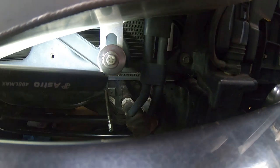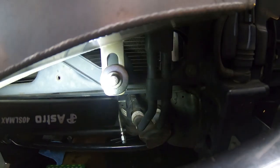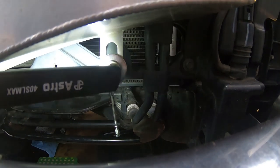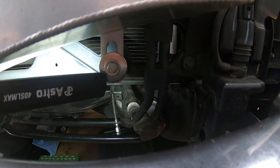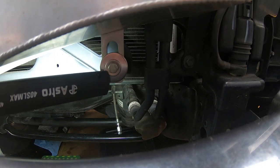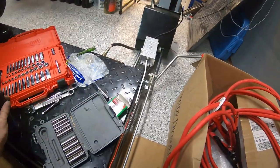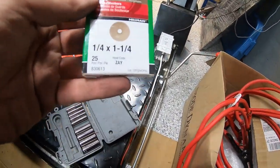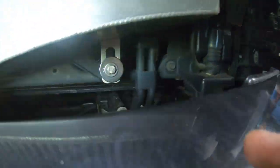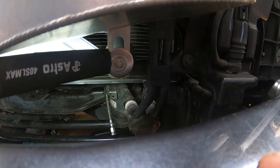Now also on the front of these, I had these quarter inch bolt fender washers, and put them underneath the factory washer that came with it, because you can see the smaller factory washer on top and these elongated holes in this intercooler. This little small washer really wasn't big enough to grab this mounting tab, and the washers were kind of wanting to fold inward. So I just happened to have a box of these 1¼ inch fender washers. And as you can see, they worked out quite well, just to add some additional meat and grabbing capacity of this bolt on that mounting tab.